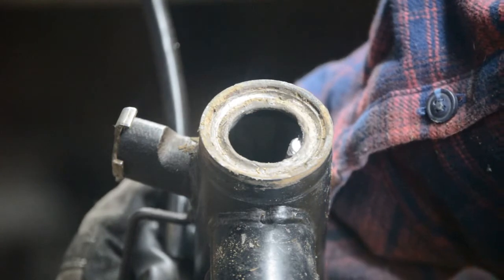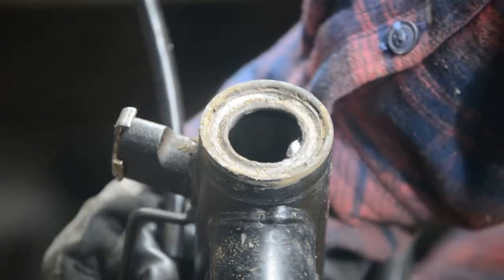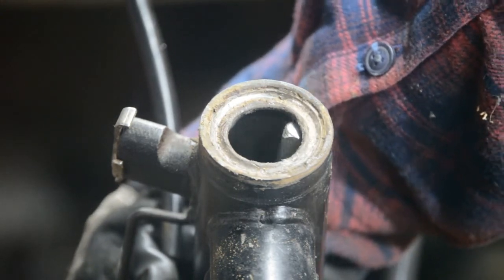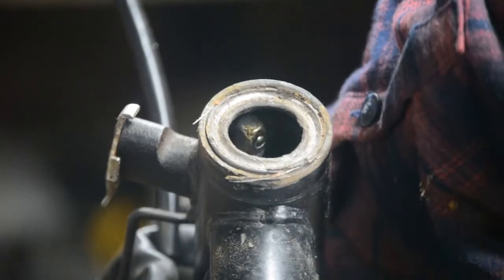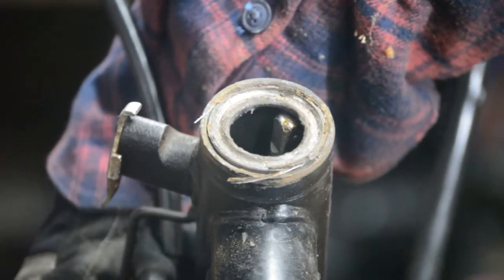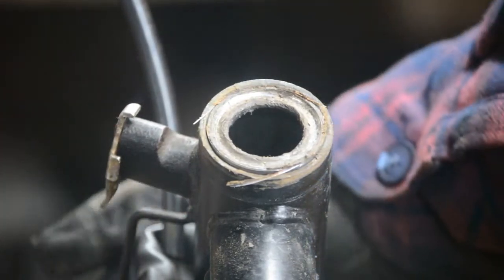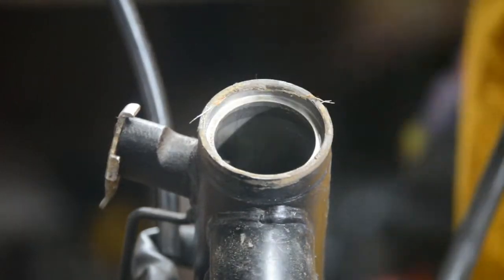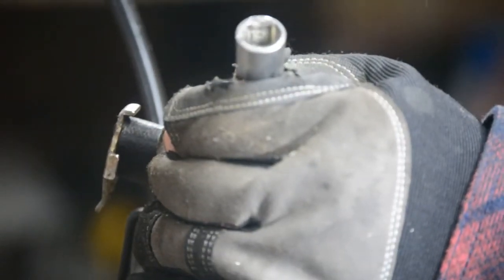There's no real sophistication to this — it's just a case of whacking it out, to be quite honest. Drift on there. Instead of just hitting it all the time in one place, we're going to work around in a triangle configuration, so we're not making the cup come out at an angle. We want it to come out as flat as possible to help prevent jamming. It's coming out fairly easy — just awkward because we're working upside down. There we go, that popped out. Good. There's no actual corrosion where that cup would sit. I just need to take the bottom cup out now — it's exactly the same process.